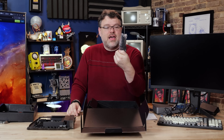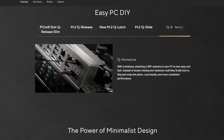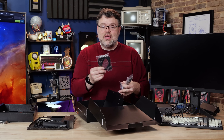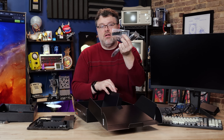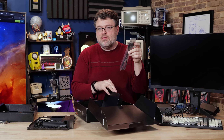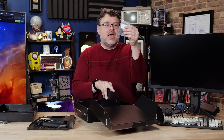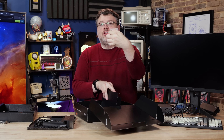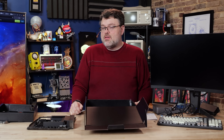You get the fancy Wi-Fi antenna. This is a different style of antenna connector that is quick release — it doesn't thread on. It's nice, it's premium. Wi-Fi 7 is very fast. You get a lot of other accessories: SATA cables, M.2 mounting screws, a ProArt ruler slash bookmark, rubber headers, and a very short DisplayPort cable. This is for DisplayPort in for the onboard USB 4 — it's Thunderbolt compatible. We can't call it Thunderbolt, that's an Intel technology, but you can use Thunderbolt peripherals with this board, though there's a caveat we need to talk about. You also get extra thermal pads for your M.2 — a 22-110, so you can run 110mm M.2 on this motherboard, which is a rare thing.